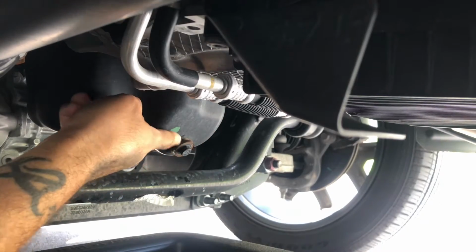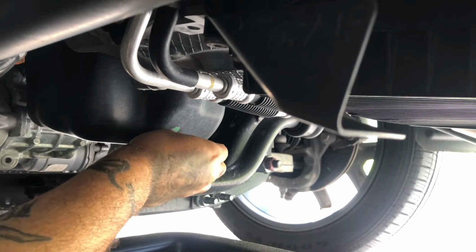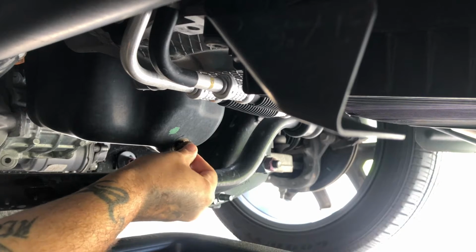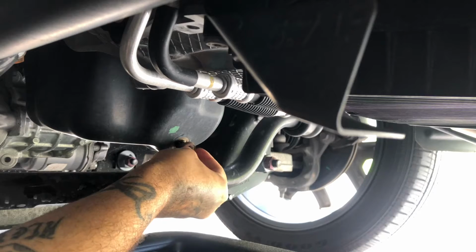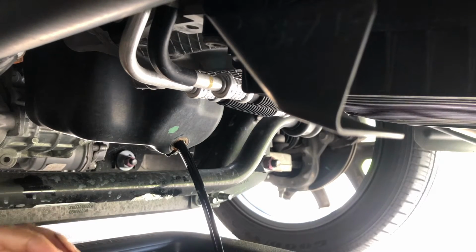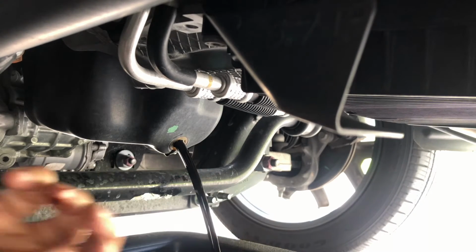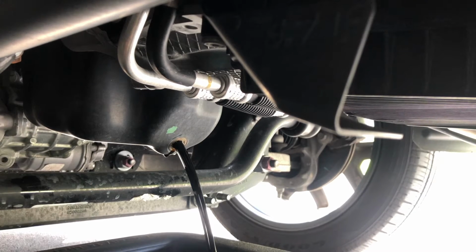Like I said, once this comes dripping out, it's going to be all over this sway bar. There's nothing you can do about that. You're going to hold it in like this, and you're going to turn it out until you feel a slight click. That way you know it's done, and then you're going to pull it away, and you shouldn't get anything on your hands. If so, no big deal. Right now it's loose. There you go. Got one drop on my hand, but what? You're a mechanic. It's far worse than that. One drop. You're going to let that drain completely for as long as possible.